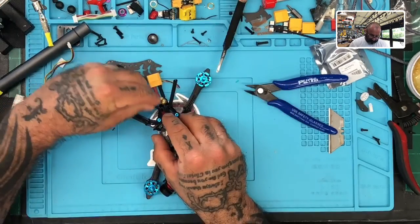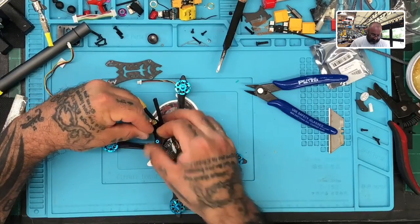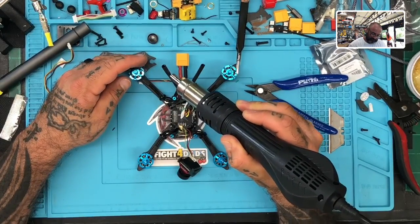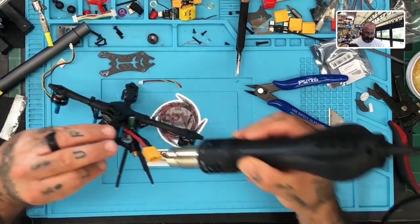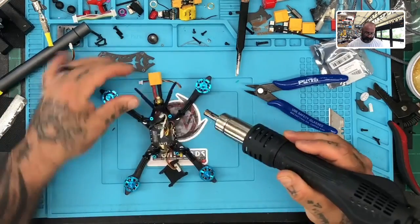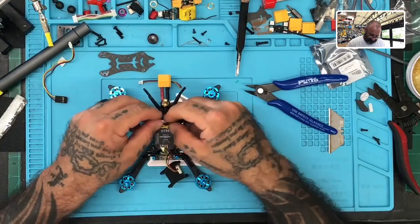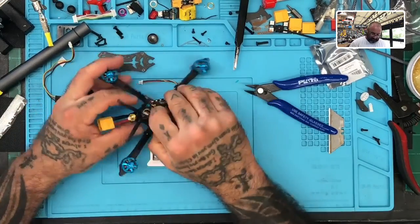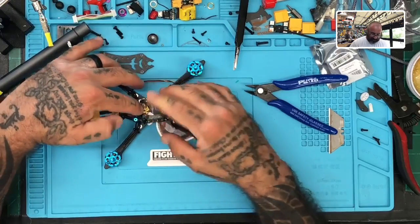All right, let's get this antenna down. We've got our antenna in place. I'm going to heat this up quickly and fix this permanently. Put these wires back here, and this way the customer can still get to the bind button. When he's done binding, he can just leave the wires laying out like that — that should pose no problem at all.